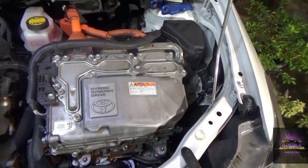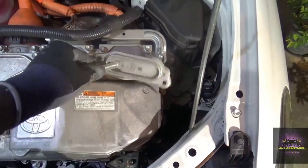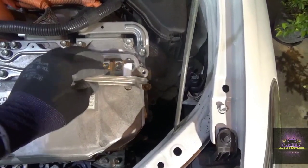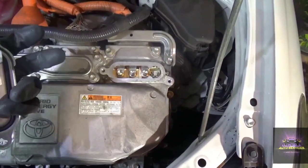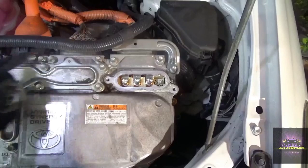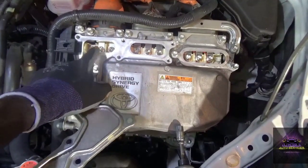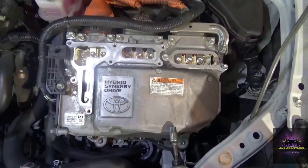With those released I'm going to take off these covers and replace the bolts. When you lift this cover off, you have to lift this one off first - you cannot try to bend it back. You'll see this yellow and white tab here - this locks in, and this is one of your safety features. When you remove this it automatically kills the power, so this is one of the interlocks. I'm going to release these bolts also and do the same thing on the side. I'll get my multimeter on this to double check that I'm not getting any voltage coming out from this port - coming straight from the battery. This is MG1 and this is MG2 - I've got to make sure I'm not getting any voltage from these cables.